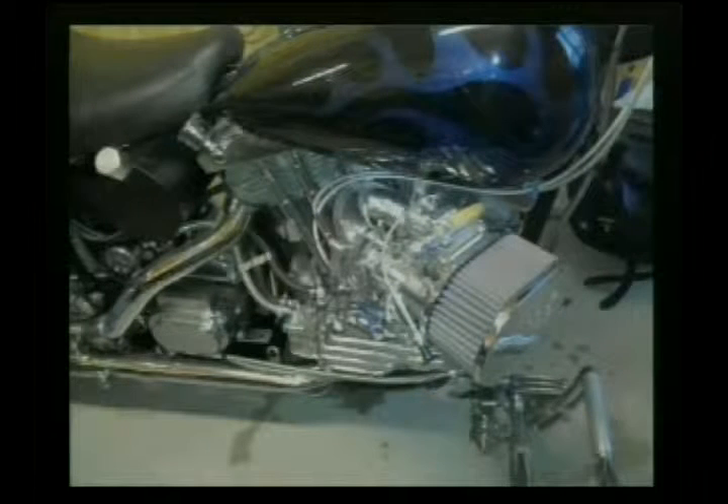See this little block right here — the throttle wire block? One of them didn't fit. One went right in, and the other had a thread on it for an S&S-style fitting, and these were not threaded. I didn't want to grind on the threads on the cable, because that's how a small project turns into a monster project. So what I did was I tapped out that bottom hole in the aluminum. I went and got a tap-and-die set, got some lube on there, and tapped it. You know that sound it makes like it's going to break right before it starts cutting threads? But I got it all in there and it went in like a bandit — tightened right up and it was all very happy.